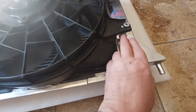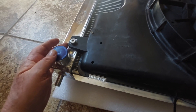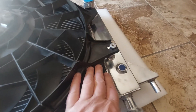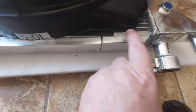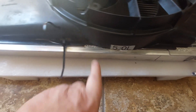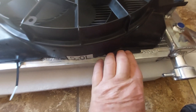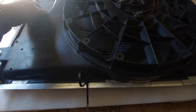If you look, these are the mounting bosses — they're just a little bit long, only about a half inch. So all I did was open up these slots so it can drop down a little bit farther. Then up at the top I relieved around the welds — you just have to take a look and see where it's contacting. Now the plastic is flush against the radiator.